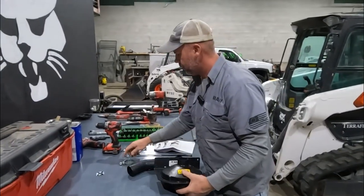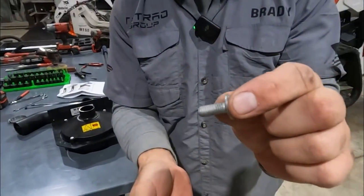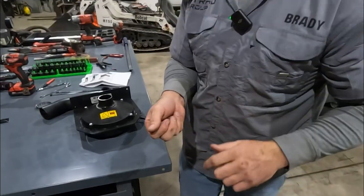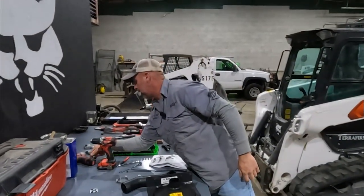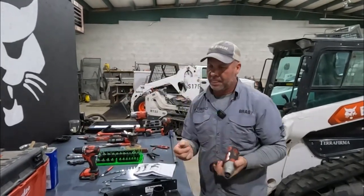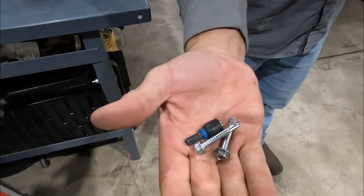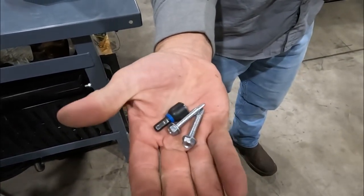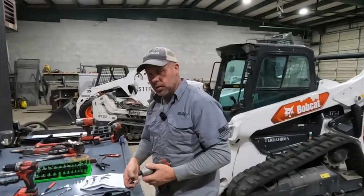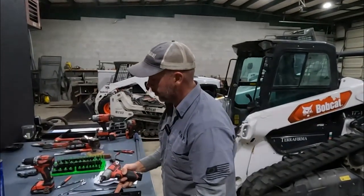Now we've got our tube. Here are those little mounting screws, but since the instructions said to use a 10 millimeter drill bit, I'm not going to use those today. I'm actually using some tech screws - some self-tappers - and that way we can get this in there quick, kind of held in place temporarily. That way we can test and make sure everything is going to fit, then worry about getting our main bolts in there later.